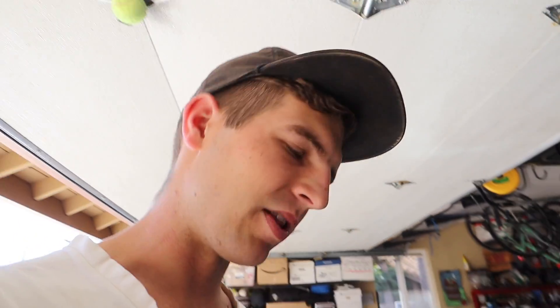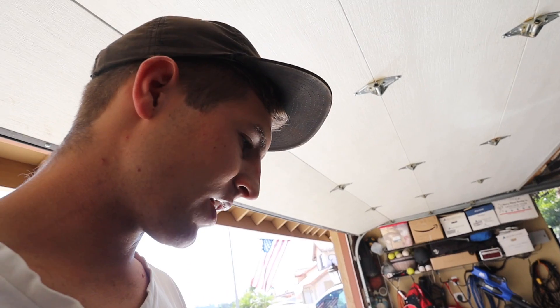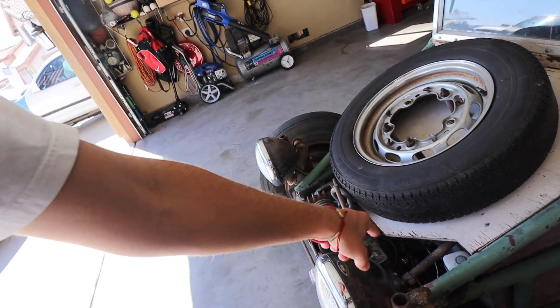I'm debating on what we're gonna do today. I think we should fix the brakes so we can actually drive this. Basically what happened is I was driving the car two days ago and the master cylinder — there are these valves on either side that connect to the front two tires. You can flip off the front two tires and only have rear brakes when you slam on the brakes, but that is sketchy. So we are going to be taking out those valves because they are leaking, and hopefully that just solves the whole problem. Then we bleed the brakes and make sure that one tire doesn't lock up. So let's take this apart and just fix those valves.